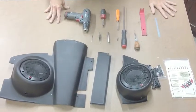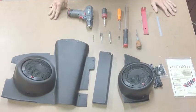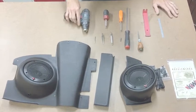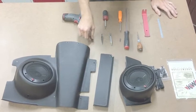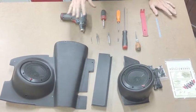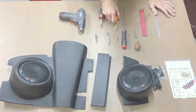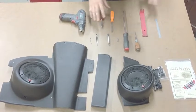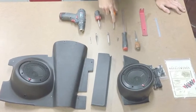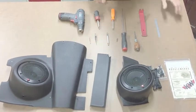These are some of the tools we're going to be using for the installation today. A small drill driver — I prefer using a drill driver over an impact driver for more lightweight interior stuff, a little more delicate. A pilot drill and a 1/8 inch step drill bit. We're only going to be drilling a couple holes and they will be in the plastic panels. An assortment of Phillips screwdrivers — No. 2, kind of typical stuff. You can get most of it done with a little ratcheting driver, but you may want a narrower or longer thin-shank style for getting through the couple back holes that go into the flange, as they're a little tight.